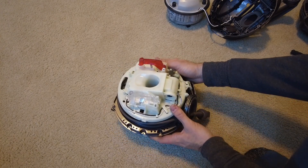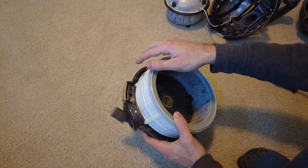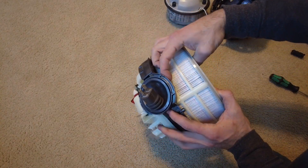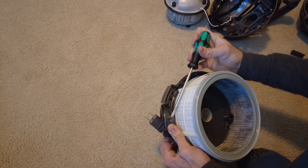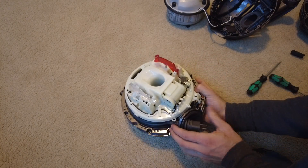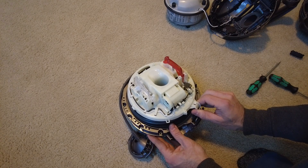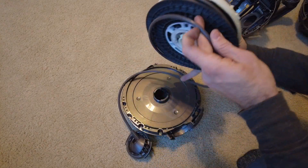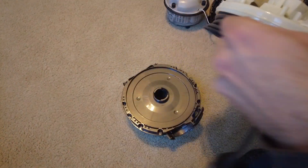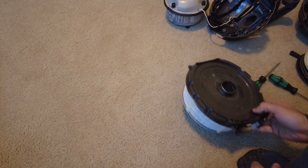This leaves us with just the filter and cord reel assembly. To remove that, flip this over. There's a little plastic tab right here that has to be popped free to remove this cable guide piece. Then you just twist it like that to the side, and it lifts right off as an assembly from the filter. And there is the filter. Oh, Dyson. Never change.